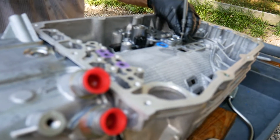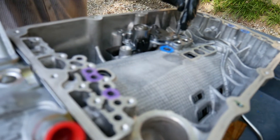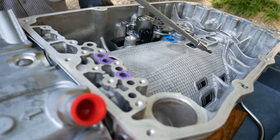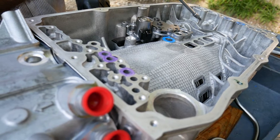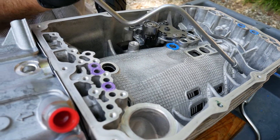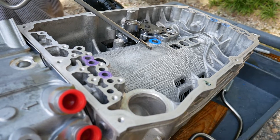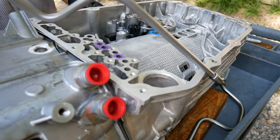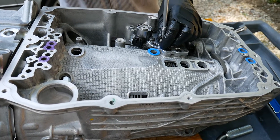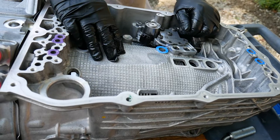Here we're removing the aluminum fasteners for the parking pawl actuator — all fasteners are the same length. You'll notice the tarnishing of the magnesium-aluminum case internally; when first disassembled it was bright, shiny, and clean with no hint of oxidation. Just from exposure to moisture in the air, it takes on that grayish-blue tinge. After years in service the external case looks dark bluish-gray, while the inside stays shiny, protected from oxygen by the transmission fluid. Putting it through a transmission shop washer will bring out a corresponding blue-gray finish.